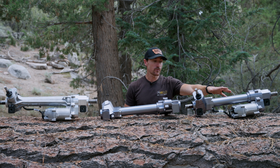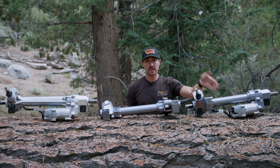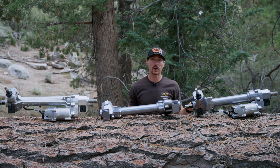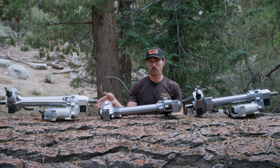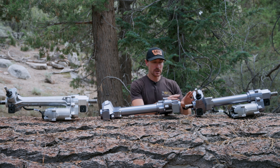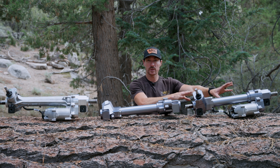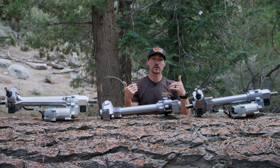Our stage three is a Haas 3.0 that we gut. We buy a rack from Ford Performance, gut the rack, put it into our housing, program the rack, stick it in a box, and it's plug and play. Take your old rack out and drop ours in — there is no programming needed and it works in any model of Ford Bronco. We now also have an option for Ranger Raptor, which is different because that Raptor model has steering modes: comfort, normal, or sport. We're able to accommodate that on the programming side. Two different products — they look the same, but Ranger Raptor and regular Bronco are slightly different on the stage three when it comes to electronics, but both are strictly plug and play.